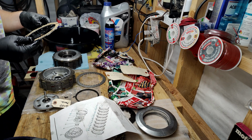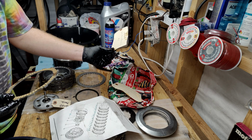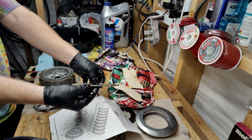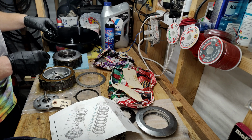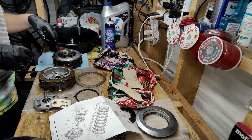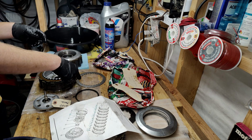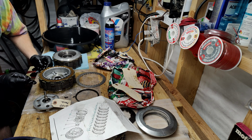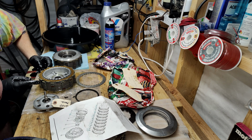Okay. So this one is 130004. Give the old dip, got the blue tab. And that one is always offset for some reason, in everything I've ever done. So why start now? But now let's count before we put that on, because I got this plate here and I don't know if I have just an extra one or what. So we went the springs, friction plate, metal plate. Friction plate, metal plate. Friction, metal, friction, metal.